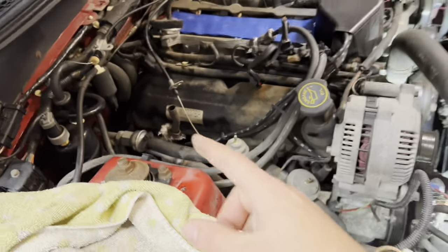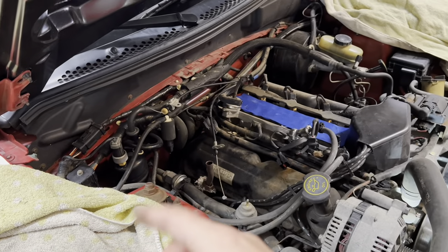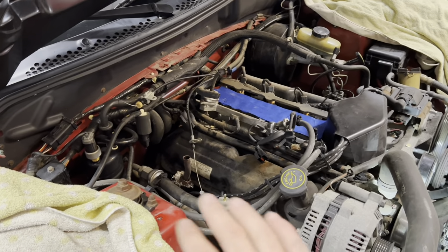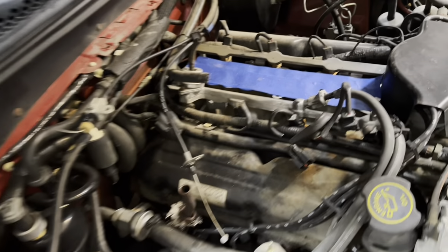Still pretty fun and nothing's been too stubborn yet. I am worried about the exhaust manifold bolts, but I think I can just disconnect the exhaust manifolds at the bottom and leave them connected to the cylinder heads, then deal with them once the engine is out. That's going to be it for today - thanks for watching. We'll get another video going on Monday. Like, share, subscribe, and if you're interested in any stock parts, let me know and we'll see you soon.